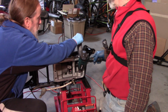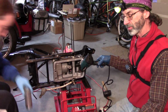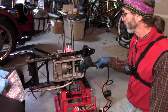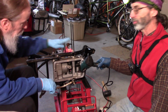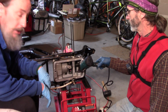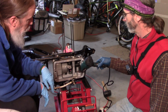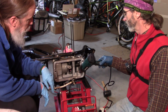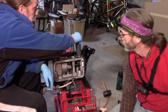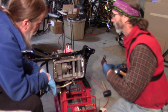And I'm heating up the recess area. We're hoping it's just going to go in, and then we'll measure it to the proper spec to make sure that the O-ring has the right pressure on it. Because if you get it in too far, it sucks the O-ring in, according to all airhead lore. Yeah, that's the post-80s era. Okay, let's go for it. See, that's that chamfered head. That's what they originally did in the factory, is they just kind of press fit those guys in there.